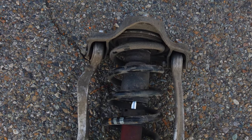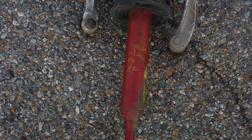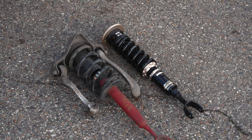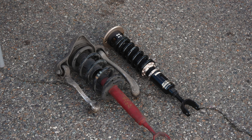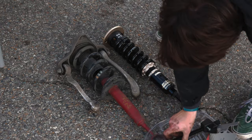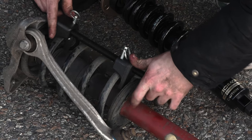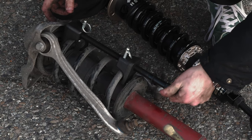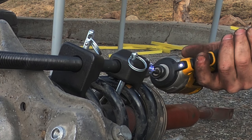Here's what it looks like outside the car, and you can see just how old and beat this is. Both of the joints on the upper control arms happen to be leaking, and overall this is a huge piece when compared to the new coilovers we're throwing on. We aren't done with it though — we need to reuse the metal piece that connects to the top of the car. And anytime you're taking something off the top of a spring, use spring compressors. This piece didn't end up being under tension, but you wouldn't really know that looking at it, so it's always better to be safe than sorry. If your stock suspension had failed in a way that this was holding tension, you wouldn't know until you needed to. My rule of thumb is to always take the 20 seconds to install the spring compressor — better safe than sorry.